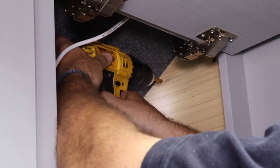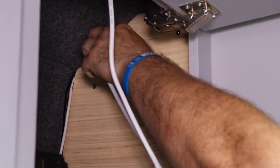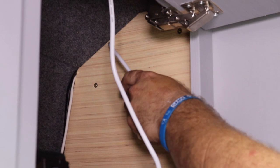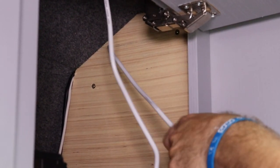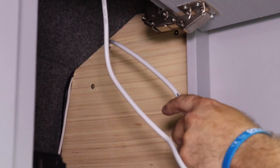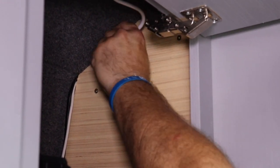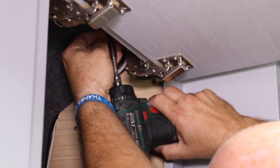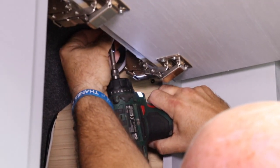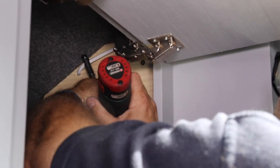Now the antenna is fully fitted, Tony works inside the cupboard. At this stage, you need to feed the clamping tool onto the cable and screw this into the underside of the mounting foot. Tony now neatly runs the coaxial cable through the divider to the location of where he intends to fit the variable signal booster. He uses P-clips to secure the cable for a neat installation.